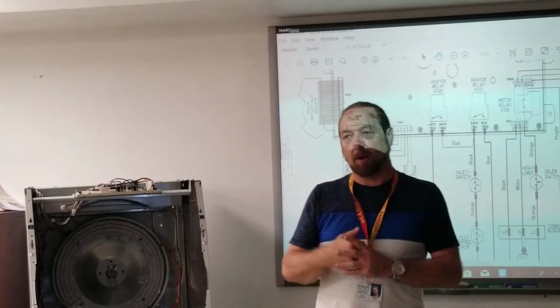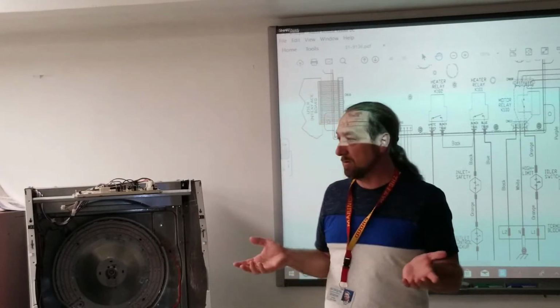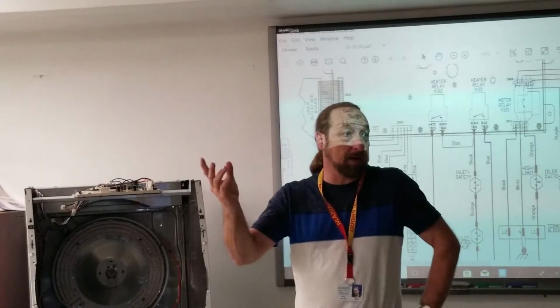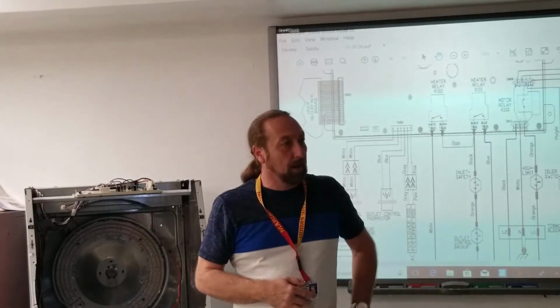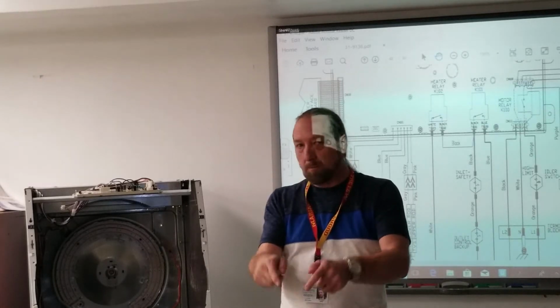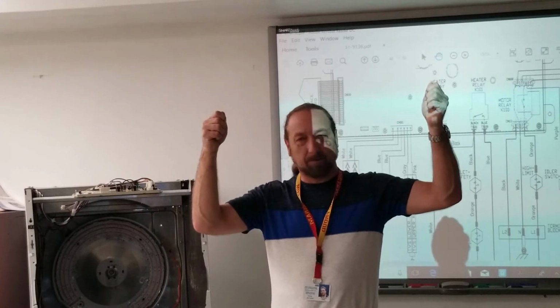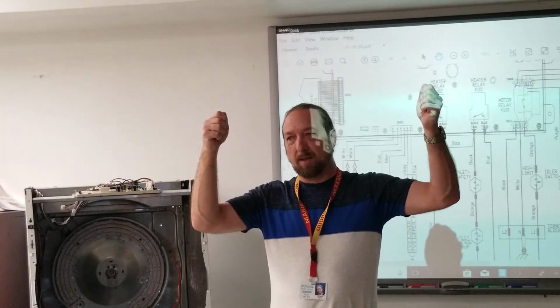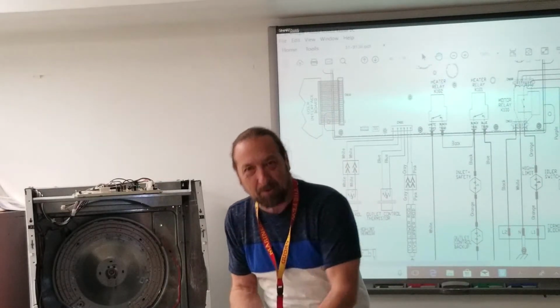He says, yeah. Okay, tell me what you got. He comes back to me and says, Richard, I don't have no voltage. I say, you've got no voltage? You have a bad capacitor, diode, maybe magnetron. Let me see. And I go over there and he's got his meter lead connected to the transformer, but the two wires, he has them off. I bring the power on now. Well, there's never going to be any power there if the wires are not connected.